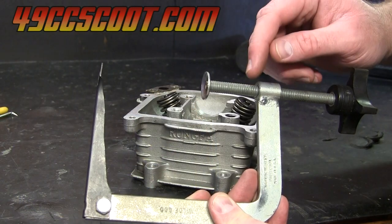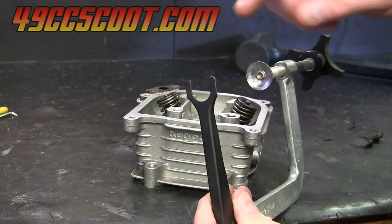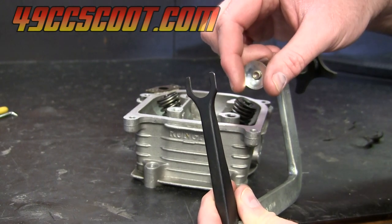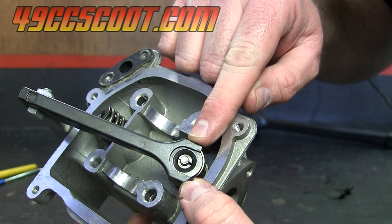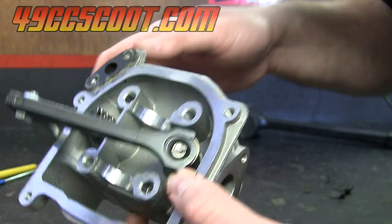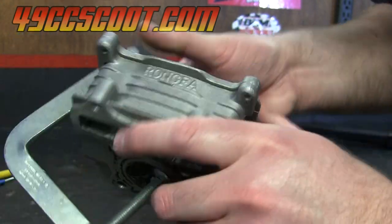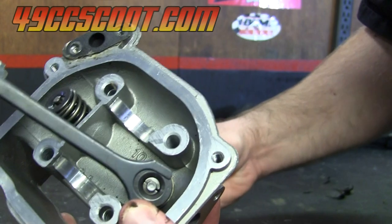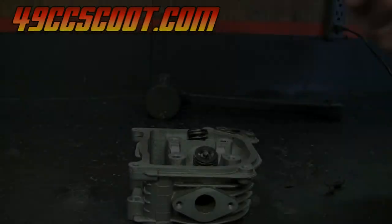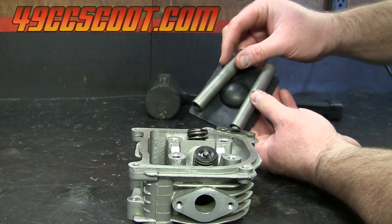It's the same process if you have the more basic version of the valve spring compressor. You won't have to choose any adapters — you've got one end with kind of a fork on it and another end that's just flat. The fork goes right over this spring seat here and leaves the rest of it clear, then on the other side you've got this flat piece over your valve. It works the same way — you just crank it down and you'll start to compress it. If you don't like that method, check out the next video and I'll show you how to use this other tool.